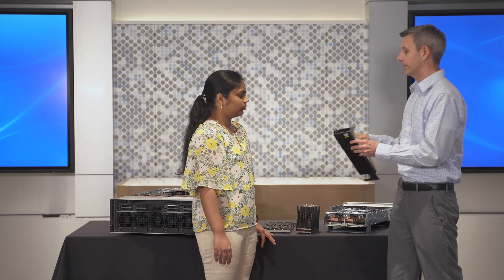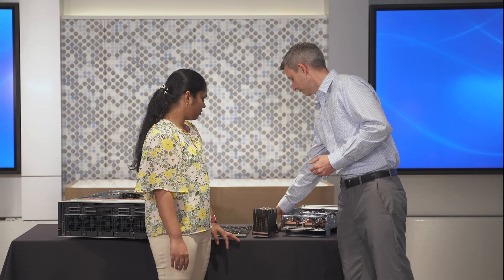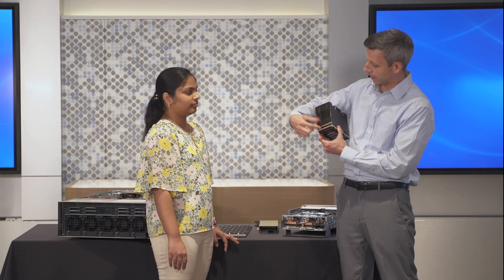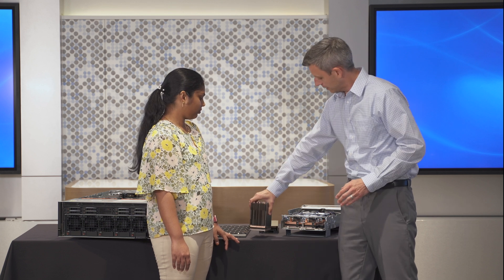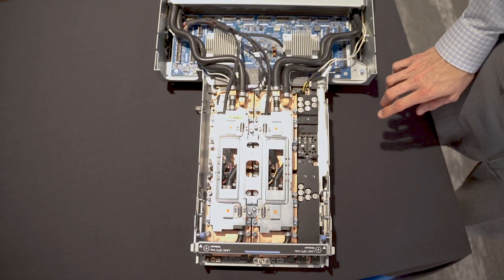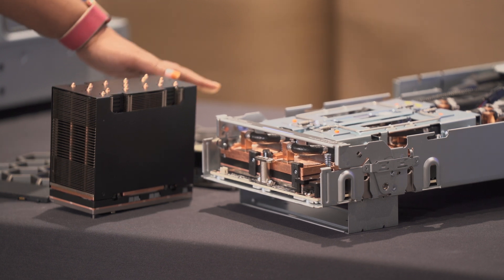I want you to understand — this is an H100 PCIe GPU. The same GPU is in here, except that it is throttled because PCIe thermally cannot do what a four-inch-tall heat sink can do. The GPU is just down here; this is an H100 700-watt with the generic NVIDIA heat sink example that they provide. What we've done is remove this heat sink, and down here on this board you can see we have cold plates on top of the same GPUs — H100, H100, H100, H100 on the four-way board. This one has the full TDP 700-watt GPUs as opposed to the 350-watt PCIe GPUs. And the NVLink 900 gig bandwidth that they share amongst each other is across all four. So across these four GPUs with 80 gigs of high bandwidth memory each, you have 320 gigs of high bandwidth memory that you can crunch one large training problem on at once.